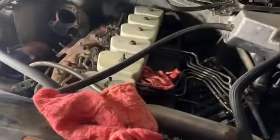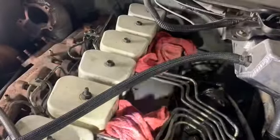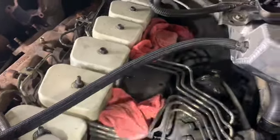I'm going to take this plate to a machine shop and have them deck it to make sure it's completely flat, because one issue I had is this side of the flange is about a 16th of an inch higher. When I bolt it down I'd have to put a lot of silicone in there, and over time it started to leak. Once it's decked, I'll go back with the factory grid heater gaskets and a common rail gasket — it's rubber with a steel inlay — which will make it a lot better. Right now it has a pretty good boost leak right there.